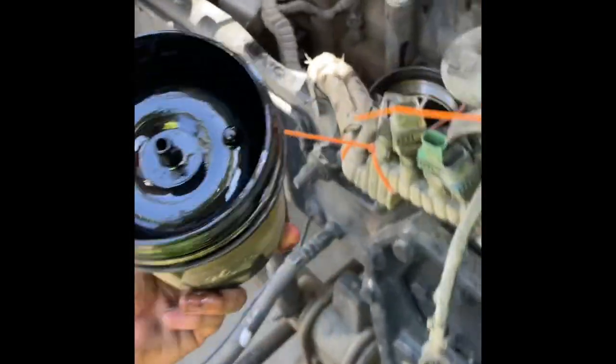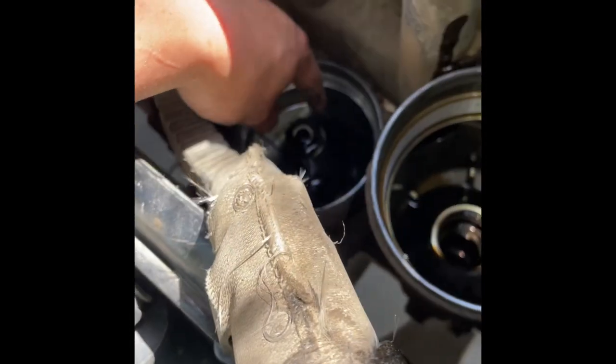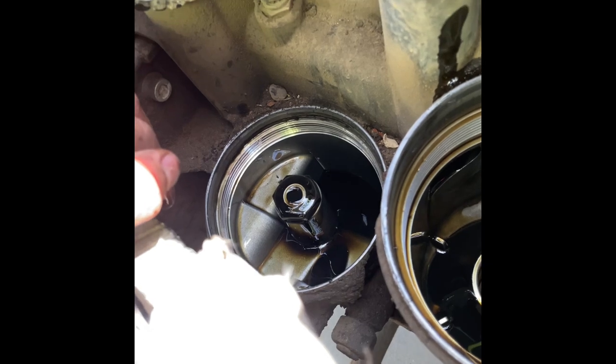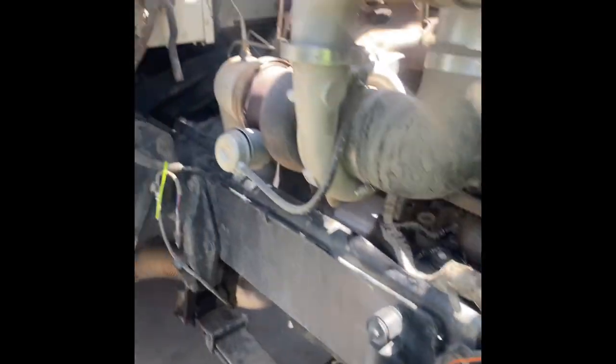The spinner filter comes out of the other housing right there — it actually spins in the housing — so you always have to make sure that bearing in there is in good shape. Let's see if it's loose. Nice and tight — that's good. Last time it was loose and I snugged it down a good amount. The stock ones are a plastic little bearing piece that gets worn out when you lose oil pressure. These are the new updated ones with a steel bearing. Lock that down — there we go. Let's pop the new ones in. Make sure you always change the O-rings that go on the cap; they come with the filter.